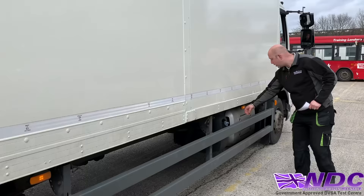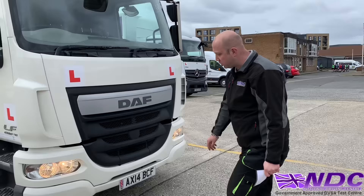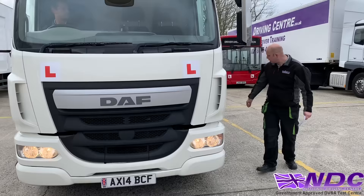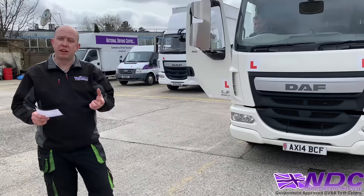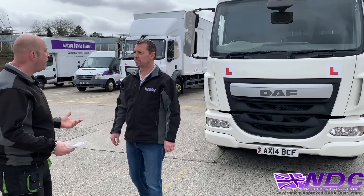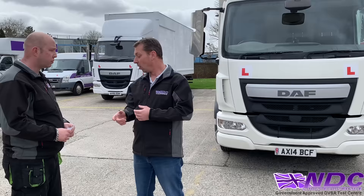Check indicator right and left. Make sure audible warning systems, if fitted, are working appropriately. If the examiner won't help, do it yourself by walking around tapping and checking. To check brake lights on your own, wedge the pedal down, use an effective surface to hold it, or use a bar if the vehicle is fitted with one. With the daily walk-around check, use the card — it's there to help. Don't try to wing it. Take your time and don't rush it.